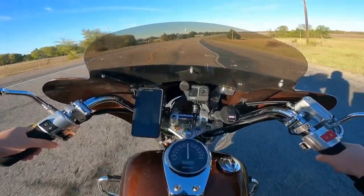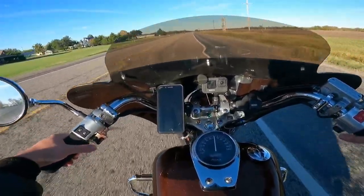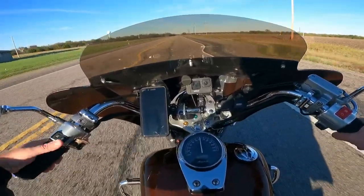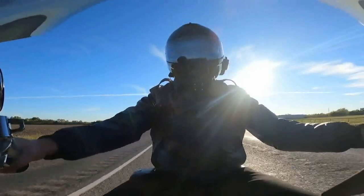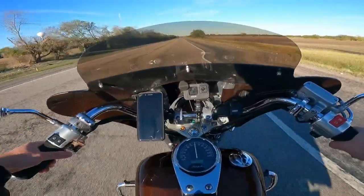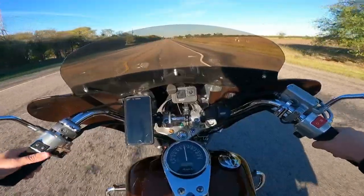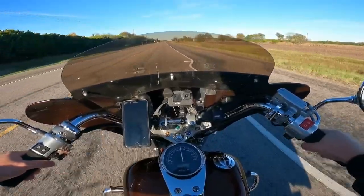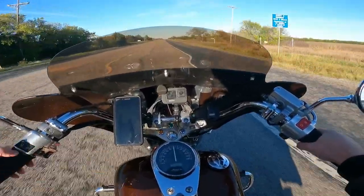So, the ABS will really benefit a lot of beginning riders that are getting used to having to use those skills that they teach in the MSF course of how to brake, without having to suffer too terribly the consequences of dropping the bike or skidding and losing control of the traction under the back or the front wheels. The ABS applies on the front and back brakes of this bike, and the rear brake is linked. So whenever I apply brakes to the back wheel, it also applies it slightly to the front as well.